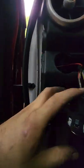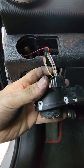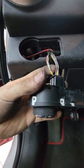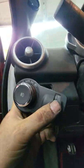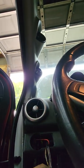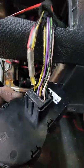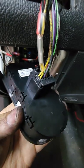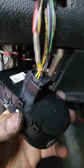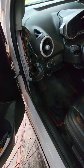That's the only 12 volt light source I found to hook it to - you could potentially use the headlights or something. But as long as you have the dimmer turned up all the way, they'll work just fine and won't flash. The yellow wire is towards the round part of the headlight switch. Now you know where to get the constant 12 volt, switched voltage, light voltage, and ground.